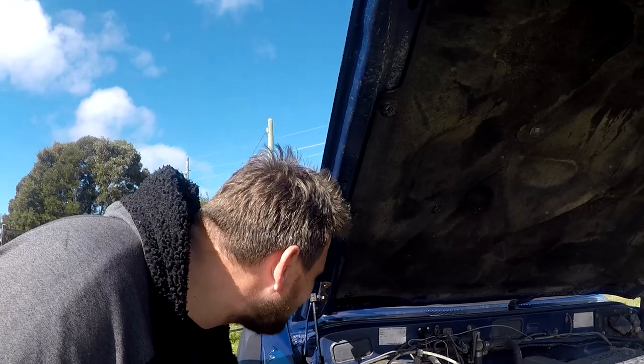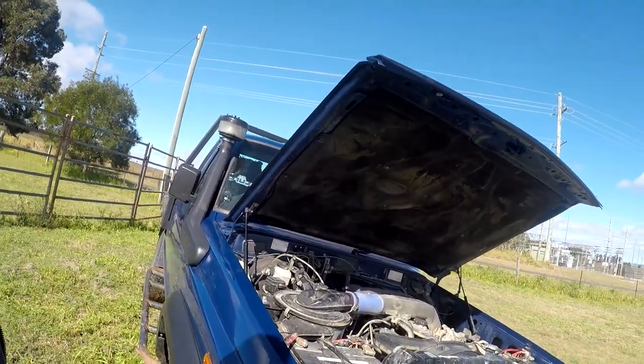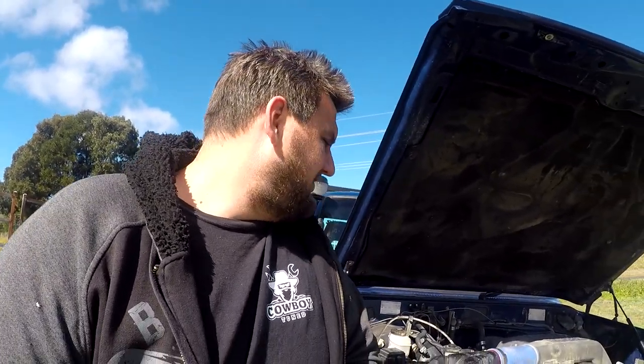She's October '89, so it's my October 1989 HJ61 Land Cruiser — modified, obviously. It is a 2H, HJ61, and I've stuck a 12HT in it. It is manual, five speed — so typical old H55F and 12HT combo.